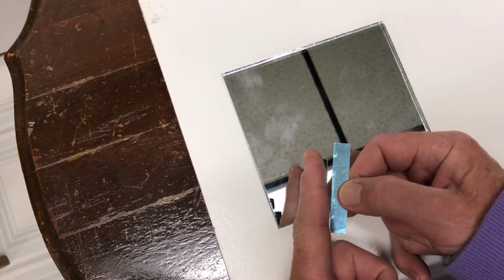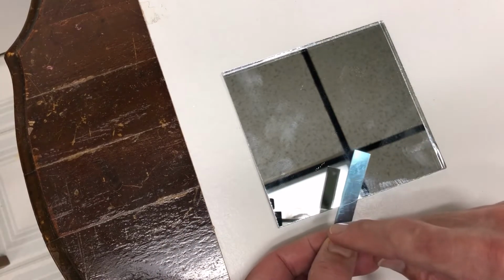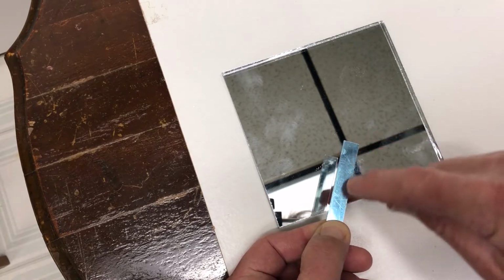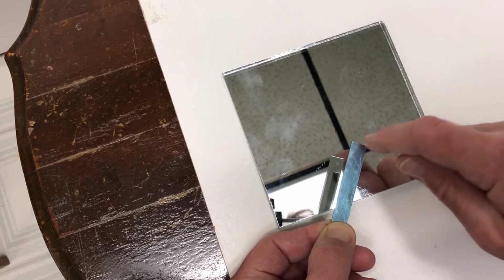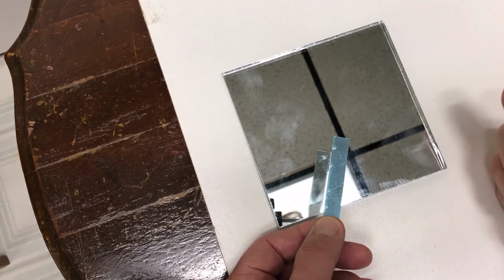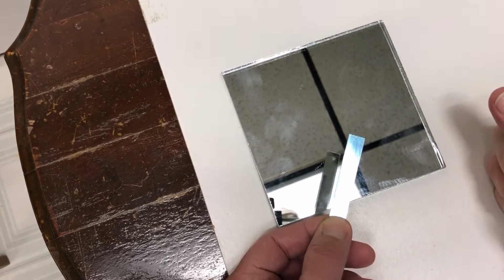If you ever have that issue and you pull the mirror assembly back apart and look at it, you'll probably find scratches right along the edges, as well as powder from the mirror coating on there too. Sometimes you can just blow this out with compressed air or something, and that minimizes it. So you can always try that first.